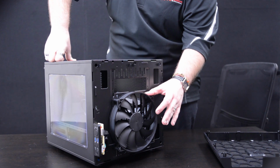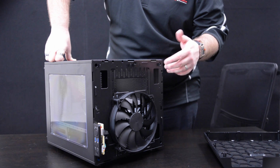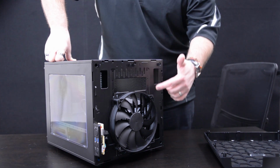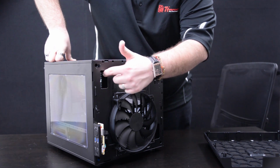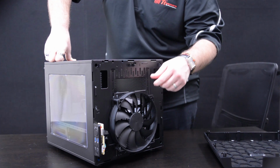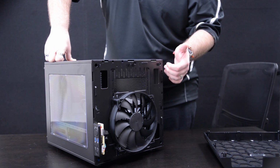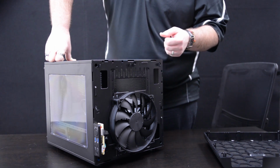This can of course be pulled just like we did on the other chassis, where you can fit radiators or fans up front. You can fit 120 or 140mm based solutions. This one can fit 120 or 240, so you can run a dual 120, or you could run a single 140 right up front. Another cool feature here, as you can see, these rectangular pockets, there's 4 of them around the corners. That allows you to relocate your front I/O to be any location so that you can actually flip the front panel to better match the build you're doing so that you don't lose access to your front ports as you set it as vertical or horizontal for the motherboard placement.